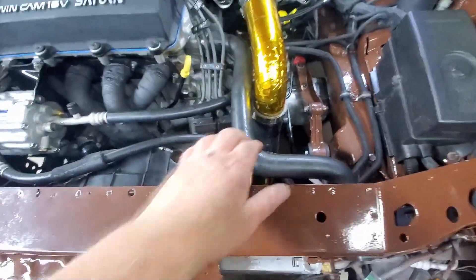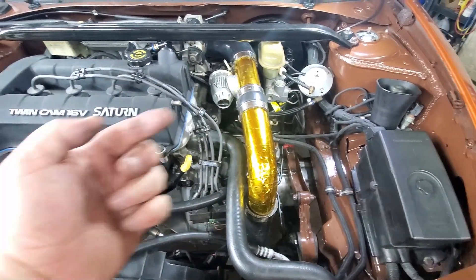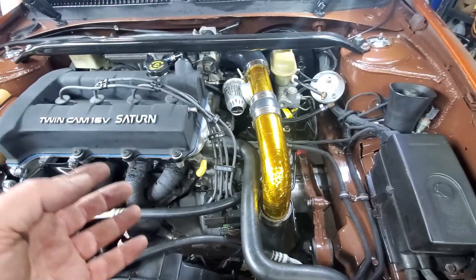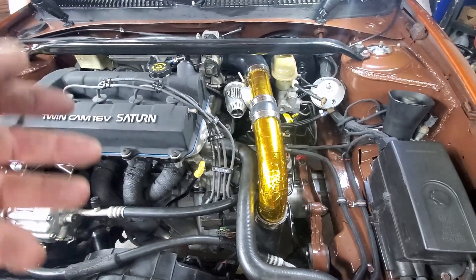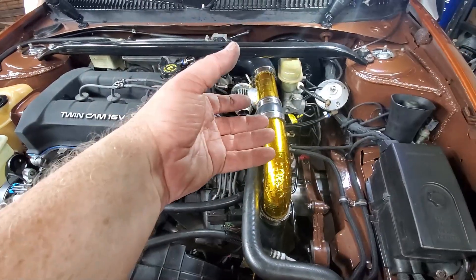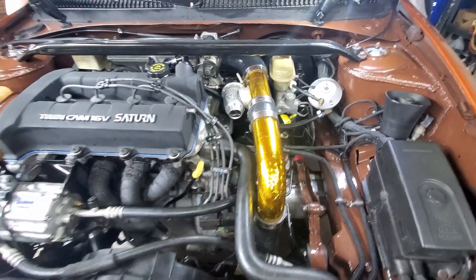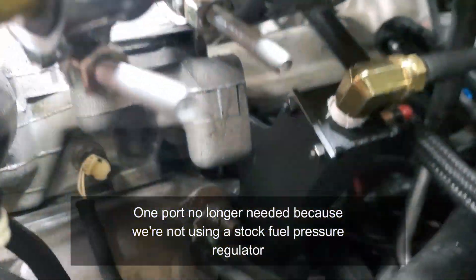Just buttoning up — I had to reroute all this piping. Because the vacuum block was pointing up that way, when the engine revs toward the firewall and drops back down, it might move a little past where it was resting before it lifted, and I don't want it hitting that. So I clocked the blow-off valve from up underneath the pipe to this side here. The EGR valve is no longer there, and I've got the vacuum block all situated inside.